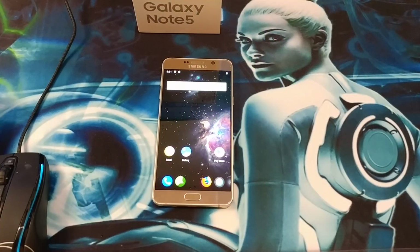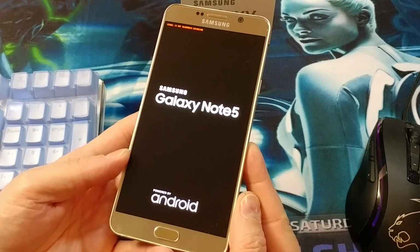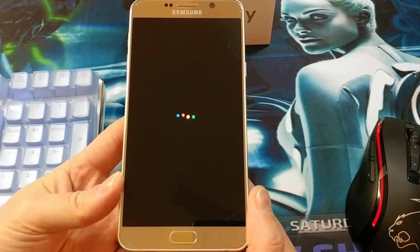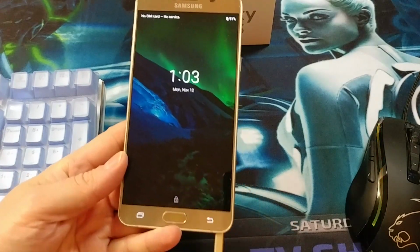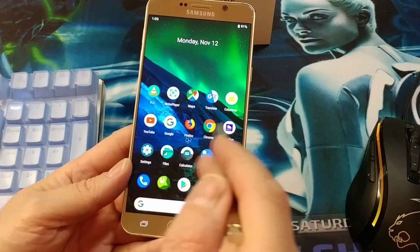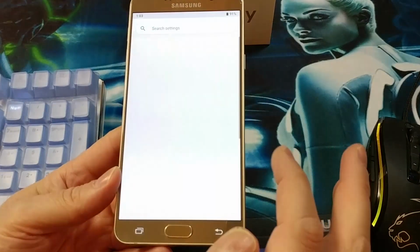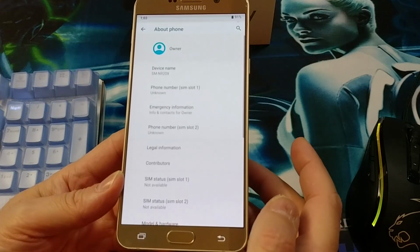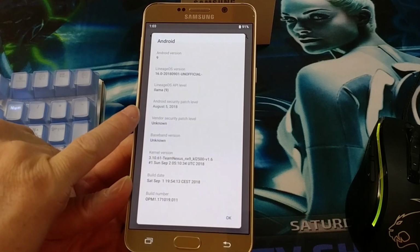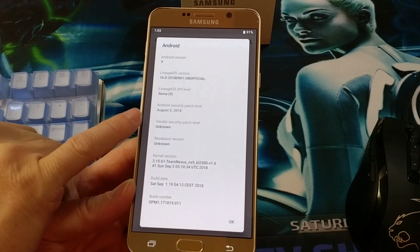Okay, just bear with me 1 second, guys, and I will install the applications. Alright guys, so let's reboot the system. See if we have now all the applications installed. The S Pen also works. In this video you saw how we can install Android 9 Pie LineageOS 16.0 onto the Galaxy Note 5. This one has an Android security patch level of August 5th 2018. That's very important because this is the ROM which you need with the August security patch.